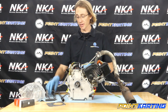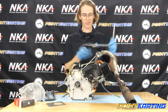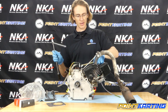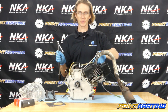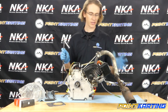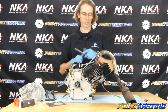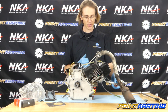Like a lot of maintenance on the Briggs 206 engine, especially on the top end, the first thing I'm going to do is use my wrench and remove the spark plug — that takes a 5/8 deep socket. This one's already broken loose, but normally you would break it loose, get it partway out of the bore, then spin it loose and set it aside. I'm wearing gloves just to keep myself isolated from the engine, since this engine is for a customer. Now I have my spark plug out.